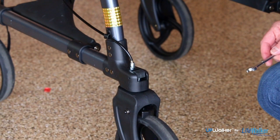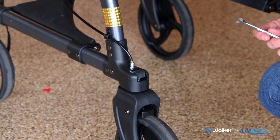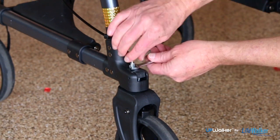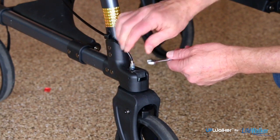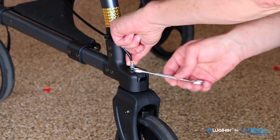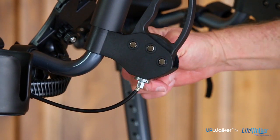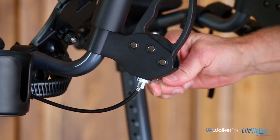If the parking brake is too loose and you would like to tighten it, use fingers or pliers to loosen the small adjustment screw, and use a 10mm or 13/32 wrench to loosen the larger nut located closest to the brakes. Then turn the adjustment screw a half rotation counter-clockwise. Continue to turn the adjustment screw a half rotation at a time until you have adjusted your brakes to the desired tension.